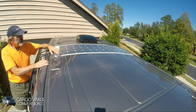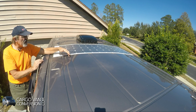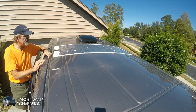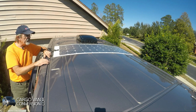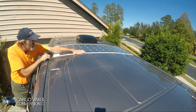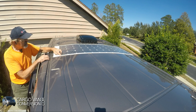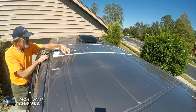The second thing, and that changes by model or brand of your car or van as well, is these corrugations in the roof. These function to stiffen the roofline, of course, and that's fine. And this part is a rain gutter. But sticking that onto the roof is a little bit of a compromise. There are areas over here that are deeper, which I chose not to fill up, and only use the tape on those parts that are sticking out.